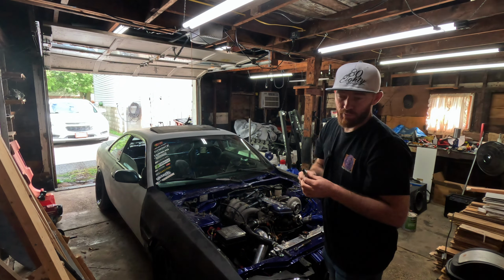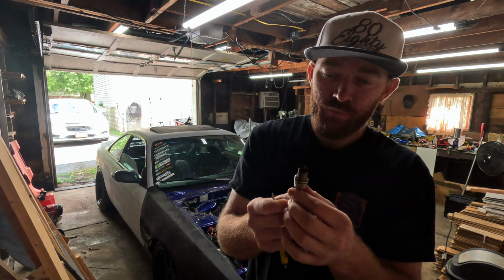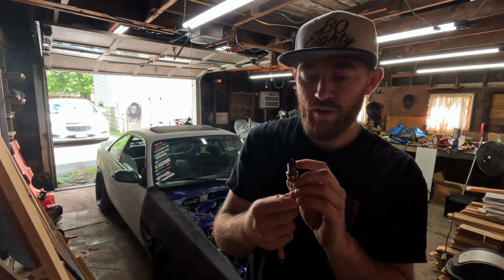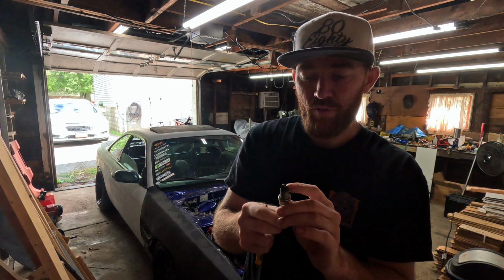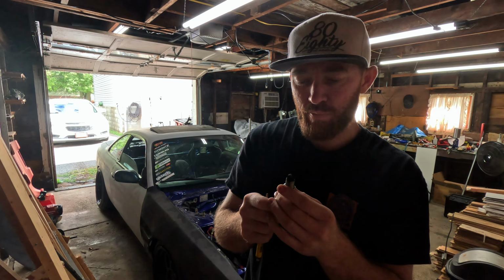Yeah, two as well. Strap is grayish in color. Usually signs of a healthy engine when it's gray like that. This one also same way though. A little bit of darkness around the electrode. Not crazy, but rich conditions. But also the strap is what's telling me what I want to see.